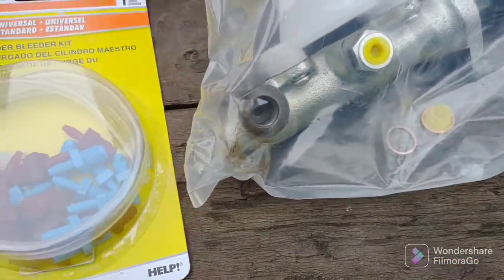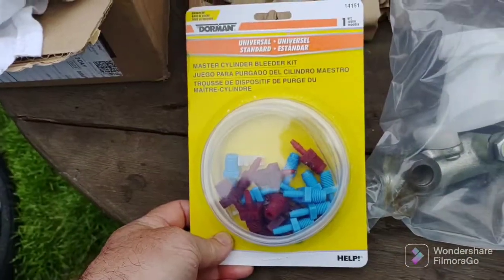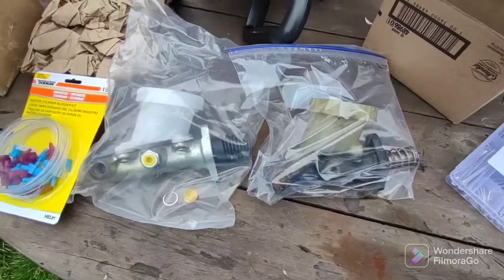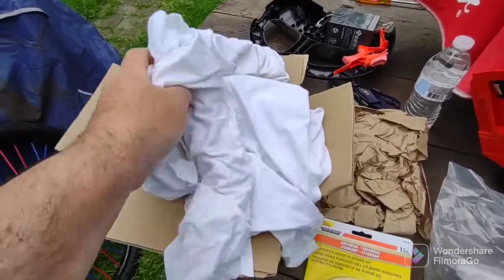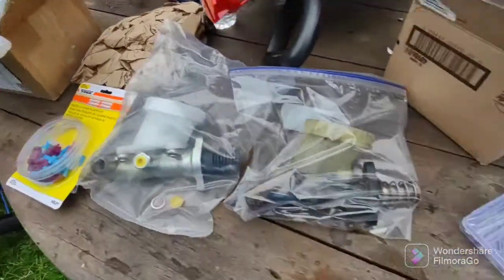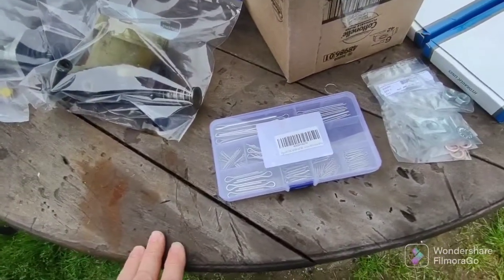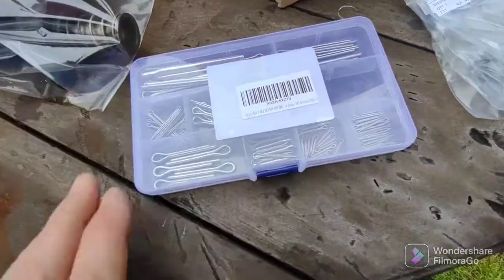Here's my bench bleeding kit - I'm doing a quick bench bleed. I don't know how good it's going to work, but it looks like it has all the different sizes to get most of the air out of the master. I've never bench bled a master cylinder before. I've got all my rags, which are extra large V-neck undershirts cut in two. I also have to clean up a lot of brake fluid from the clutch and brake master cylinder. I bought some new cotter pins because the old ones were old.